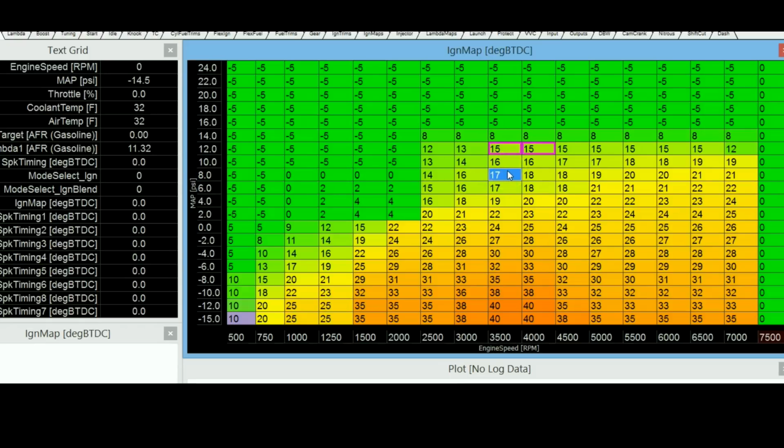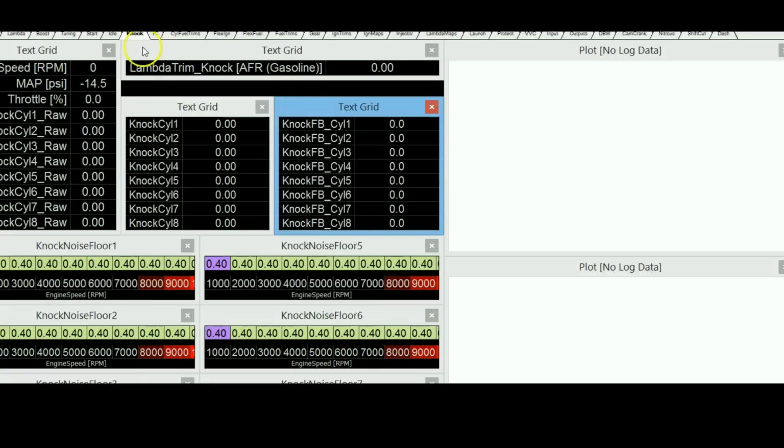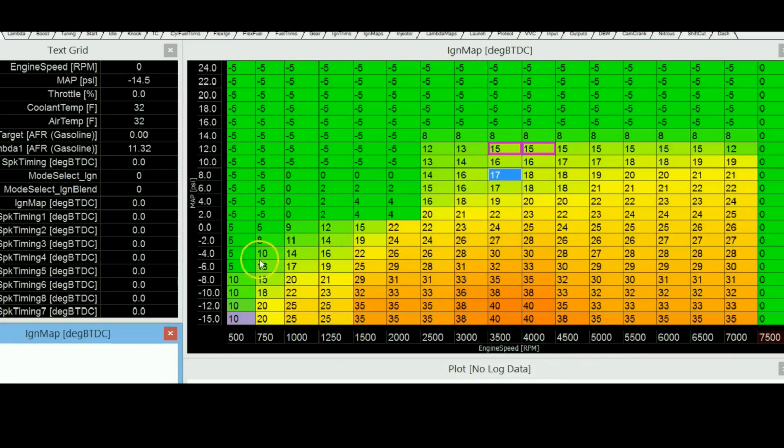where it's not going up anymore. And actually, the other thing that I look at while doing that, and the extremely important thing to look at, is the knock values. Knock is the other thing to keep in mind whenever you're setting ignition timing, because for all these lower load values, these values are not going to be knock limited. So no matter how high you go on these, your torque will start falling, but you wouldn't really detect any knock. But for all these higher load values, when there's quite a lot of pressure in your cylinder already, when you give it too much timing, your engine is going to start knocking.